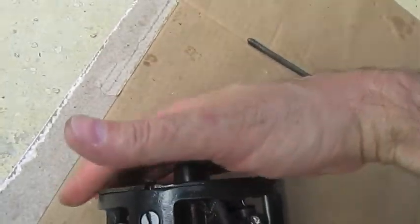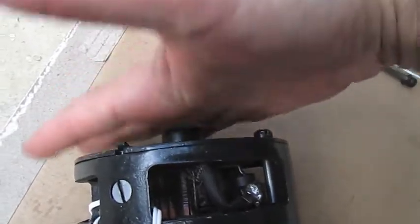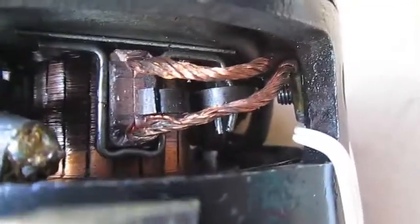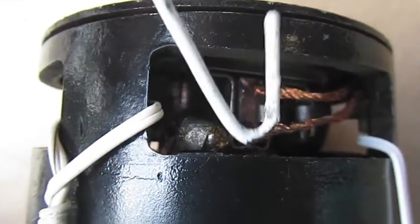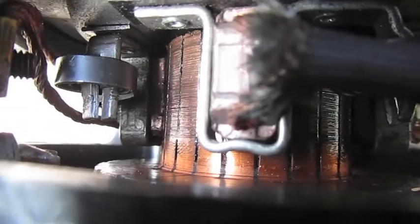Start one shoe tip, then move to the next brush and do that one. While doing this, keep your hand on top to keep light pressure so the shoes don't slip off. You have to be very patient — you won't get it right the first time. When you do the third one, notice that the spring is right in the middle of the shoe — not up or down. You can use a coat hanger bent to pull the spring up to release tension, but I was able to do it without that.